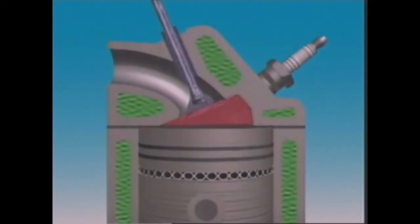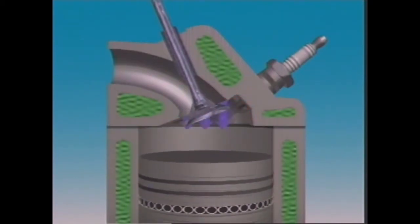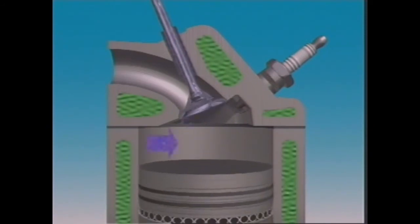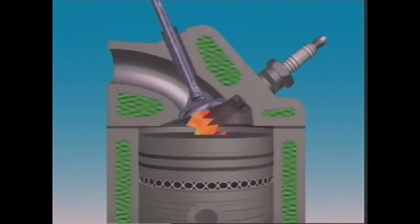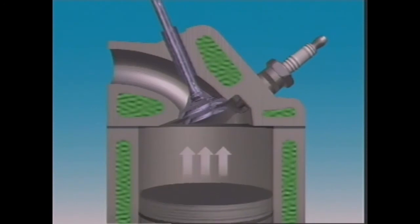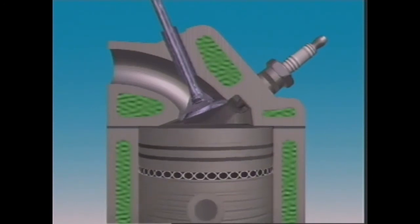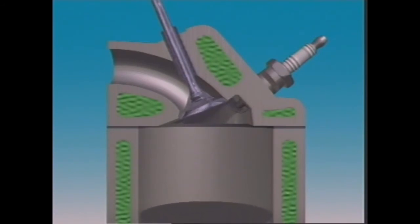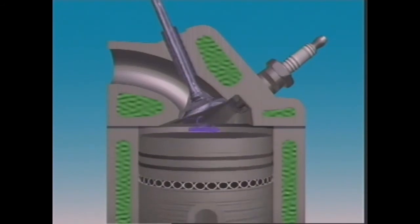The wedge-shaped combustion chamber tapers away from the plug, which is at the thick end of the wedge. The valves are in line and inclined from the vertical. This design usually has a smaller surface area than the others, with less area where fuel droplets can condense. Less fuel is left unburned after combustion, which reduces hydrocarbon exhaust emissions. And since the flame is directed towards the small end of the wedge, damage caused by detonation is reduced.